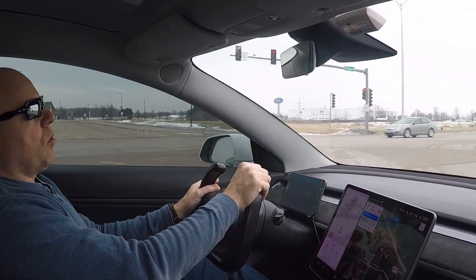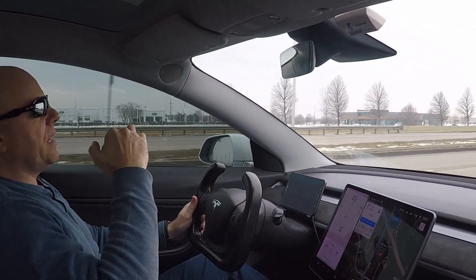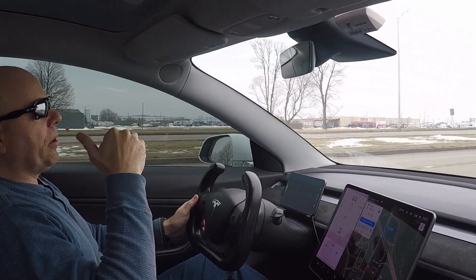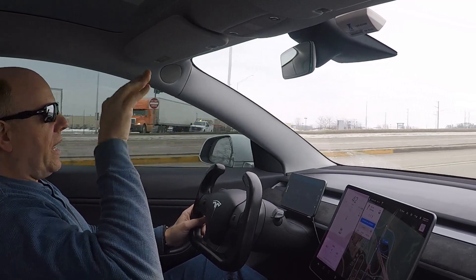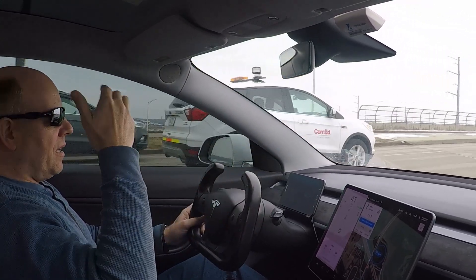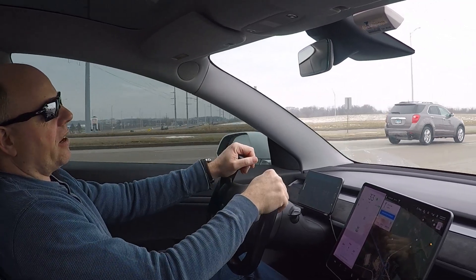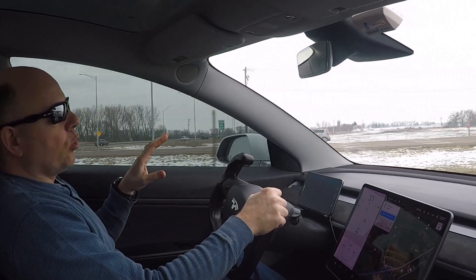The front tires — I'm not sure if the inside edge is more worn than the outside, but there's still quite a bit of tread there. However, the front tires were cupping. Cupping is an odd resonance that can occur from cornering hard — that would affect the outside of the tires. When it happens on the inside it can be from a resonance where the rubber is vibrating. As the tire goes around, it's almost like driving on a muddy road where bouncing makes potholes deeper — that resonance gives you a cupped shape all the way around the perimeter of the tire.